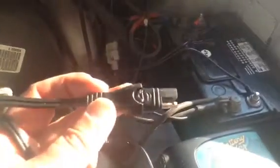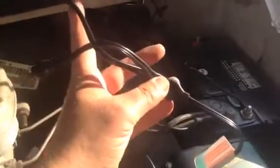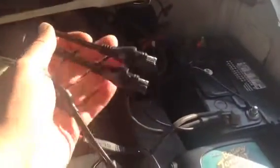Now, the other thing that happens is, with these OEM plugs, it's not necessarily polarity safe the way Anderson power pole connectors are. So occasionally, depending on whether something's an energy sending device or receiving device, you may be daisy chaining batteries or hooking other stuff up. You want to be able to reverse the pole positions on the plugs. That's where these little 2-into-1 three-way connectors can come in useful, because you can flip it by using both ends of this on different ends of a wire or something like that. The thing you've got to be really careful about, though, is that you can have a hot post here that starts scratching around or bouncing around in your engine compartment and shorts out on something. So just something to be aware of in this little life hack.